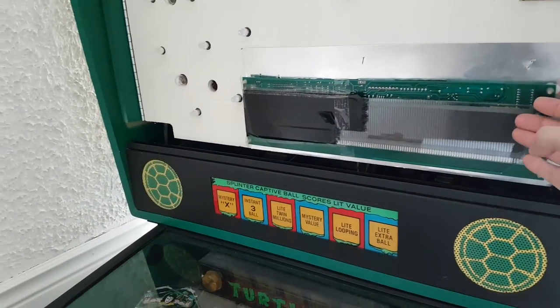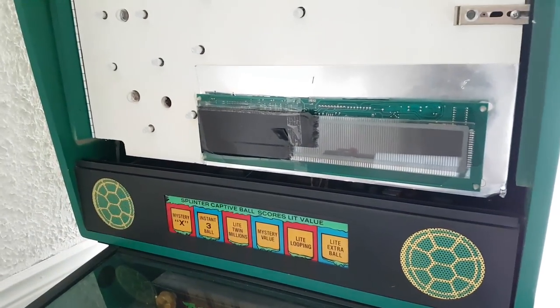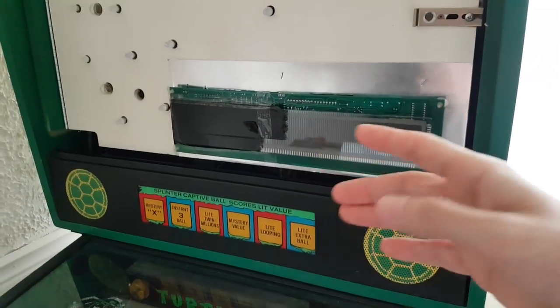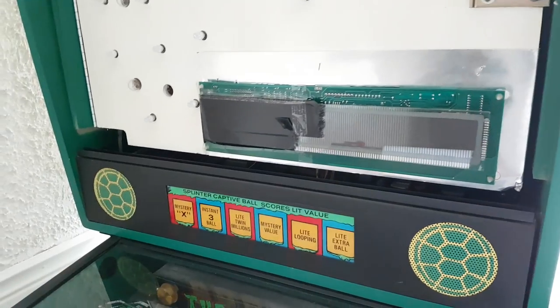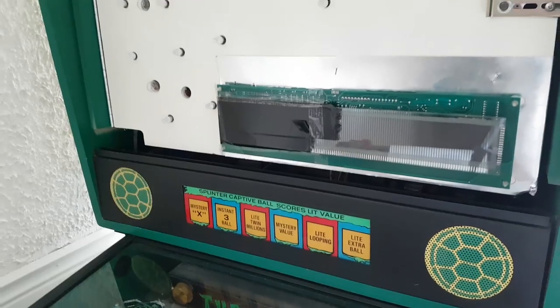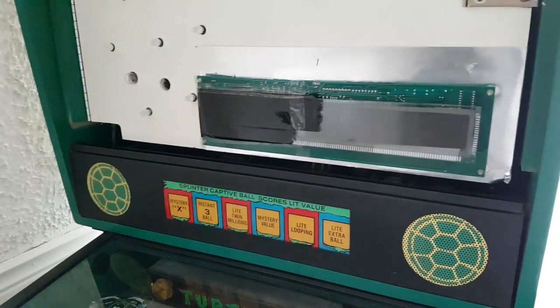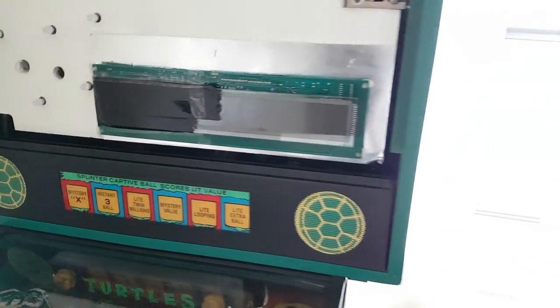The truth is it's very possible this DMD did work but the power supply wasn't giving out the plus 28 volts. Like a klutz, I went to remove it to check the measurements — I was just tinkering — and I grabbed one of the legs off the solder and it fell and broke the screen. It's not all lost because we'll pull the ROM for Teenage Mutant Ninja Turtles onto the new DMD, but it's a shame. The only good thing is it lit a fire under me to get a replacement done.